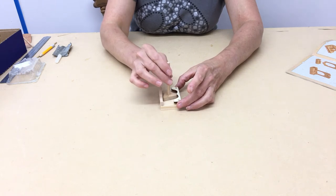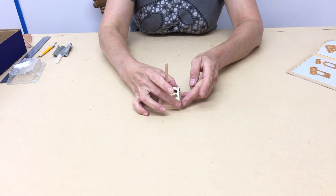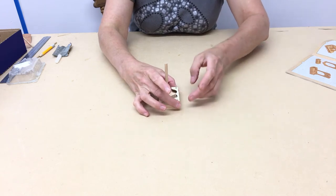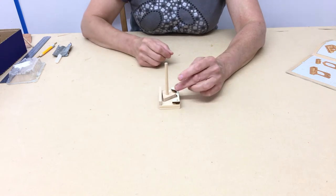But you don't want it to be too tight so it can't swing through. Most of the time, being level with the bottom is usually the right position, but it's always best to check because the cams might be slightly different with their points.